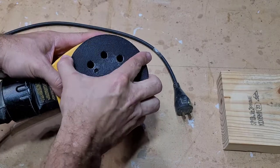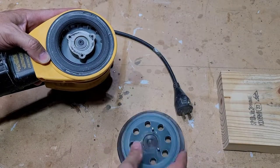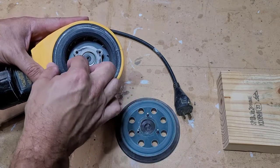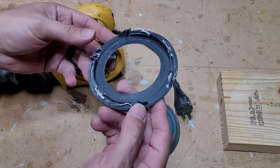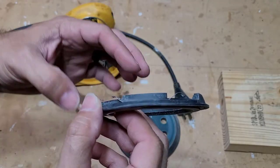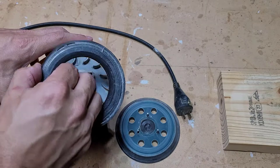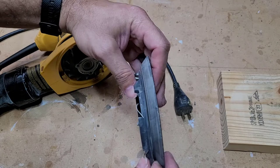That's unscrewed — you can just lift this off. And that is the Velcro pad. On this particular model, here's the brake that actually rubs against this portion of the pad. So I take the brake off, and here's where my problem is. I've already had this thing apart once, so I know what's going on. There's a spring right here that actually holds tension against this part to push the pad out against this piece right here.